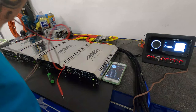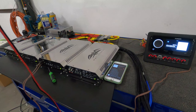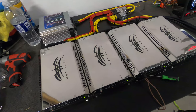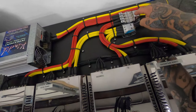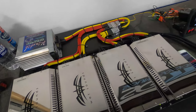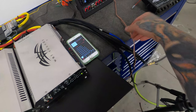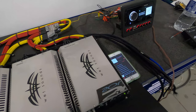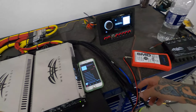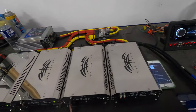All the gains are now set on all the amplifiers using the signal path we're using. You guys could see how easy that was. Now, to make our lives super easy, this whole amp board is just going to go into the boat. We'll mount it — we literally have some power and ground connections already run through the boat. We hook up some signal and it's that simple. All of our speaker connections are pigtailed out on quick disconnects because we like to play with phase on a boat.